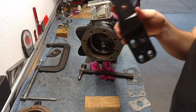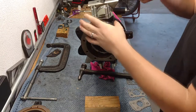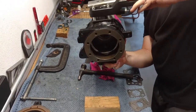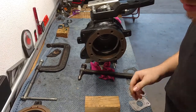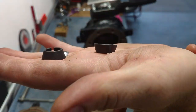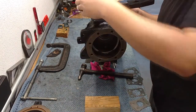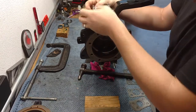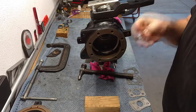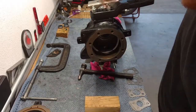Long story short, this is the passenger side and it will face towards the front. I'm going to take another one of our shim spacers and put it on there. These use the Toyota cone washers — I'm going to take four and drop them on, followed by lock washers, then the nuts.